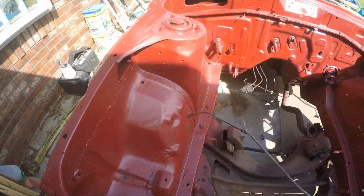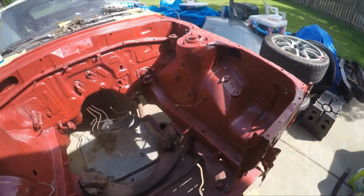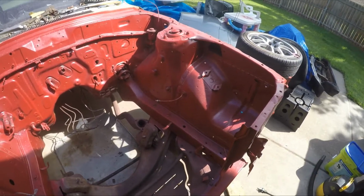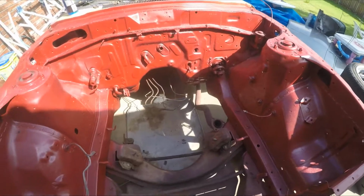I mean, that's really the biggest thing I can give you guys when it comes to welding. Just play with your welder, get some practice material, try and figure out the best settings for what you're welding. Make sure you have a good proper ground, metal's nice and clean, that there's no contaminants or anything in it. That way you'll get a really good strong bond in the weld, and you definitely want that bond, obviously. That's the whole reason you're welding.